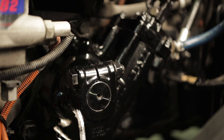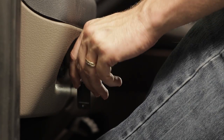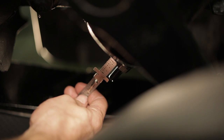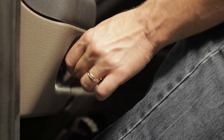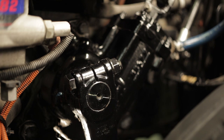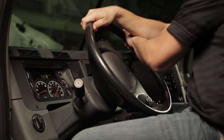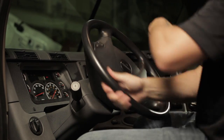The timing mark on the output shaft will now point toward the input shaft. Release the steering wheel and turn off the ignition. With the engine off, loosen the jam nut and back out the adjusting screw one inch beyond the nut. Tighten the jam nut against the housing. This will set the adjusting screw temporarily out of the way so as not to contact the poppet during the following steering maneuver. Start the engine again and let it idle. Turn the steering wheel so that the timing mark on the output shaft points toward the adjusting screw until axle stop contact is made. Pull hard on the steering wheel and hold it in this position for no more than 10 seconds, then release the steering wheel to allow the system to cool.